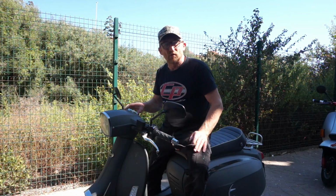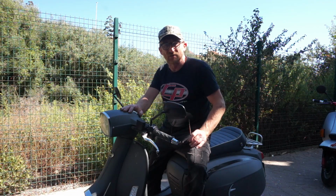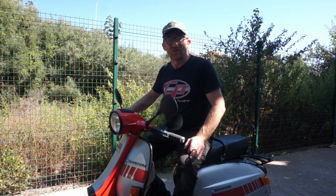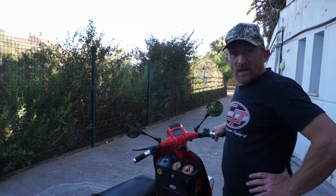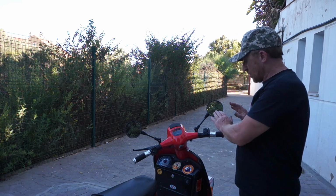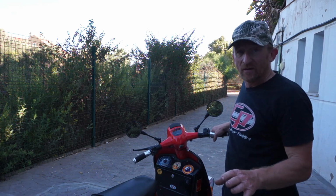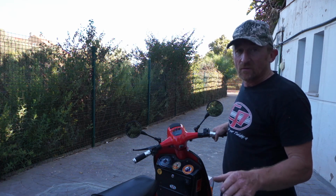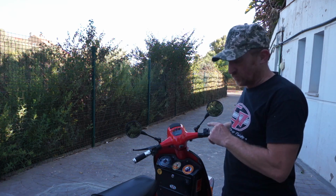So for those of you who are transitioning from an automatic scooter to a geared bike, this is a video for you. Okay, this is our procedure for the cold start of your Lambretta. No throttle whatsoever. Never open your throttle when it's cold. When the engine's cold, zero throttle.